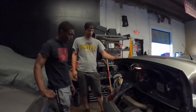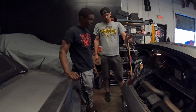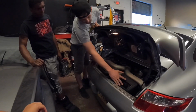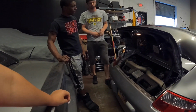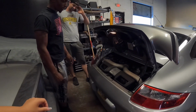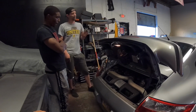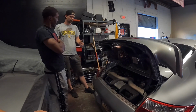What we'll do is actually run the intake up over the intercooler, because you can't fit the tubing through. But for the stock airbox, all these little grommets fit up to this. The stock airbox is so superior to eliminating it and running filters like that. It's actually not as good. I'll argue that online all day long. It's literally dyno proved. The stock airbox, as far as intake air temps, these are the best.